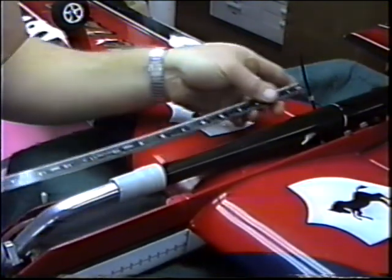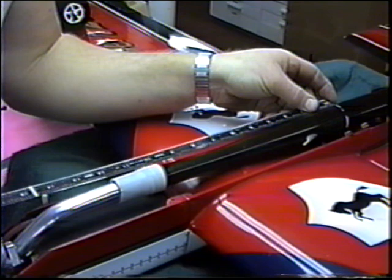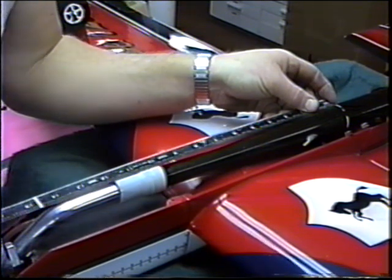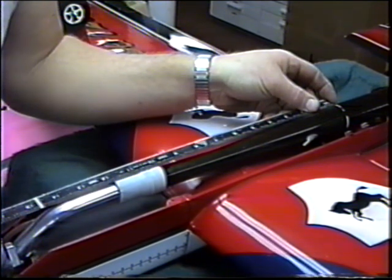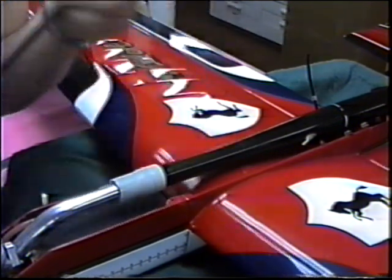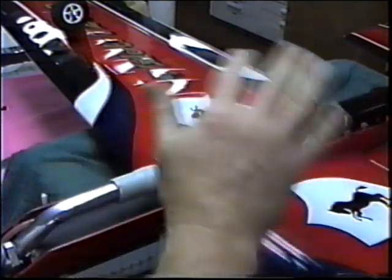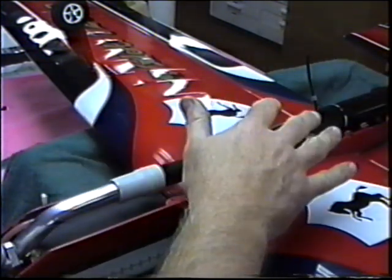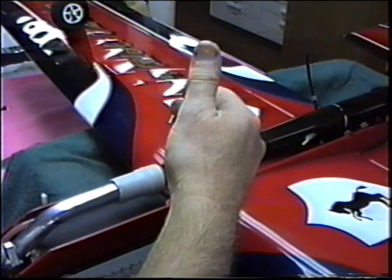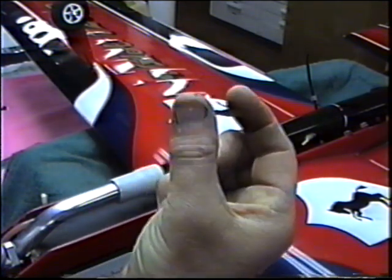I like to start with the pipe length. And remember, on a conical baffle pipe, you measure from the mean average point. Anything from 17 to 18 seems to be the range that these pipes like to run in. So if you have all the choices in the world, start with the pipe long and shorten it little by little. Don't start with it short and then try to make it longer, because then you have to put those little stubs in.